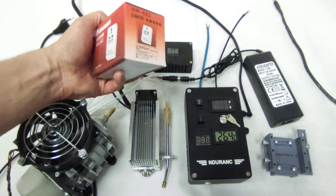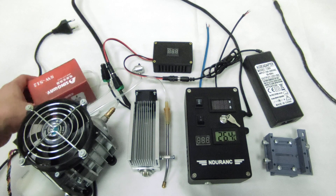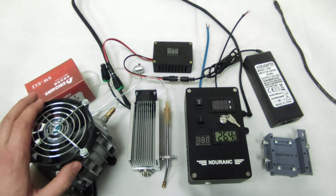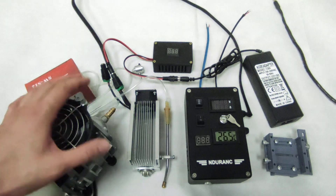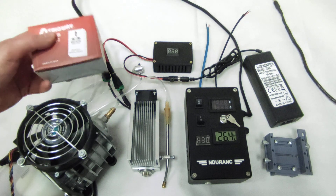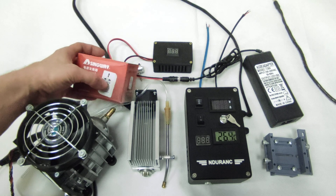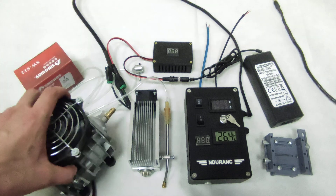Another thing: you get this inverter. You need it because most of the air pumps we send operate from 220 volts, and if you plug them directly to 110 volts in America, for example, they will very likely not work, or will work with like 1 or maybe 5% efficiency. So you need to use this inverter, which changes the output power to 220 volts from incoming 110 volts.